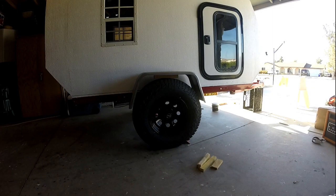Just eyeballing the fenders right now. Got the bearing deal solved — took four or five tries each wheel, on and off, on and off. But the bearing mystery is solved: zero play, free spinning, worked out. So first we're going to get the trailer level — right there. And then I'm just going to eyeball these fenders and get them level. We're playing with that right now.